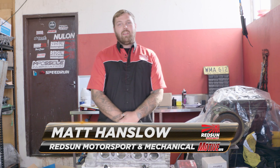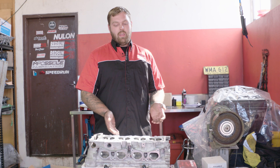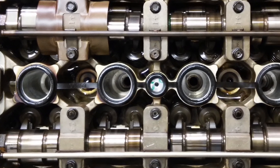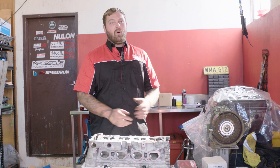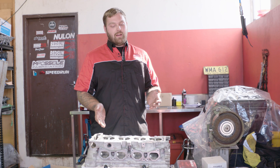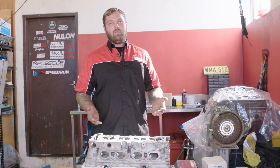We go VE head because there's no hydraulic lifters and no rockers that can explode. Big intake ports, bigger exhaust ports as well, and also a variable valve lift — it's like having two sets of cams. You switch from your small lobes to your big lobes, so you have response and then big horsepower when you want. A stock DET ported to the absolute max is still smaller than a stock one of these heads, and the ports are more direct with better flow at the valves.